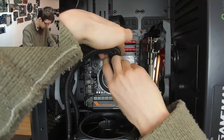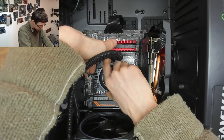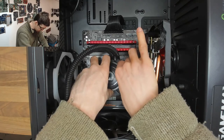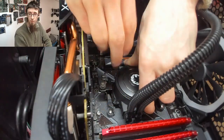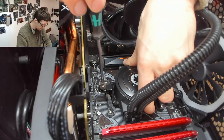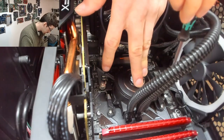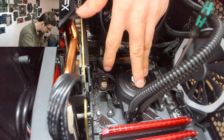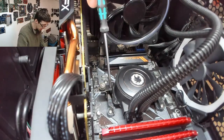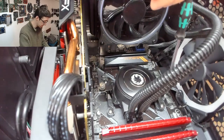Now we move the pump head around into position and hold it down on top of the CPU while aligning those two clips over the retention bracket. Once the left side is done, lift and align the right side. Once you can see that both clips are fully engaged, turn the thumb screw to tighten it up, then do the other side and take them down to the stops. As you can see, the arms will bend and that provides the spring force applying pressure onto the top of the CPU — so no need to crank these tight, just turn them until they stop turning.